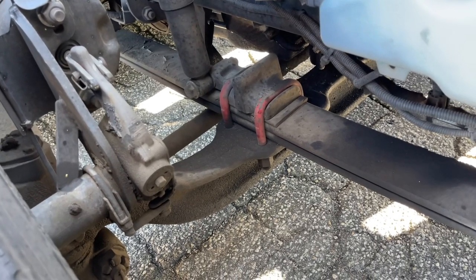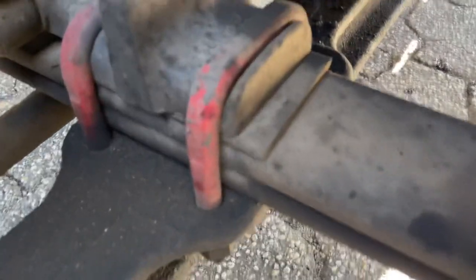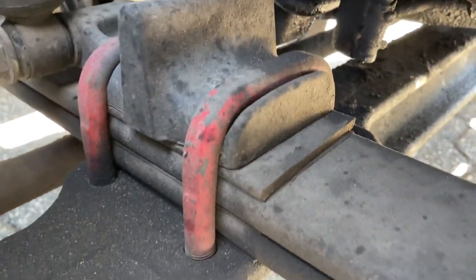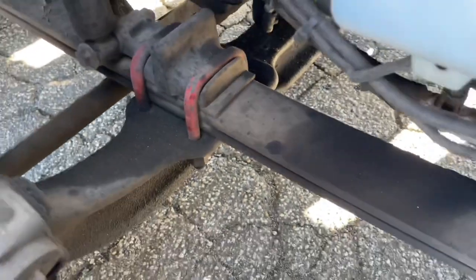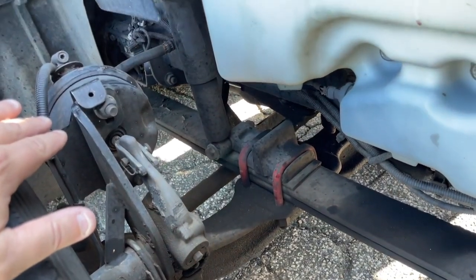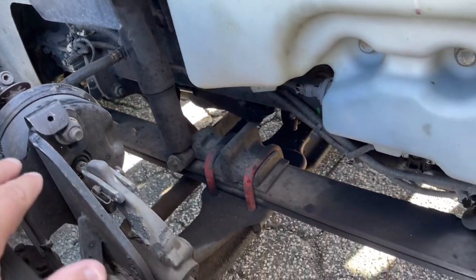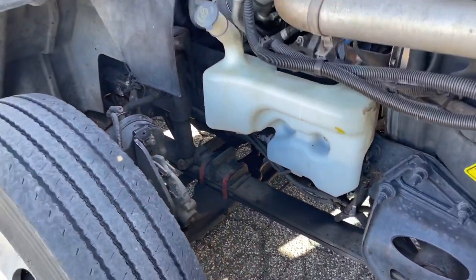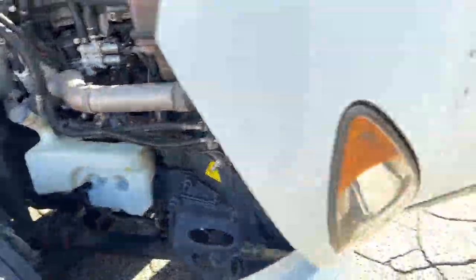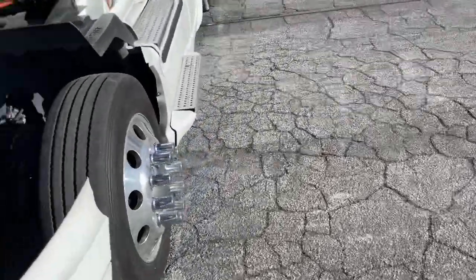We ordered new shorter u-bolts. As you can see, they're slightly tapered toward the top. We got them from a company called BETTS — B-E-T-T-S — they're out of Fontana and you can check them out online. Those are the factory shocks. Because the International sits so high, it has a lot of travel in the shock, so you can use the stock ones without ordering special car-hauler shocks.